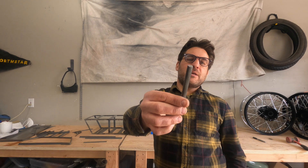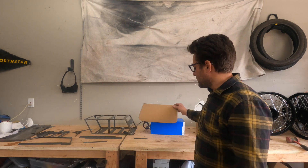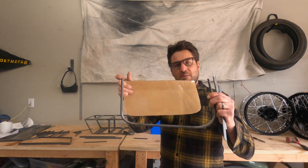As far as creating the battery box, there's no real magic to it. Basically, if you can measure and have a little bit of fabrication skills, you can absolutely do it. The basic design for the battery box I used on the C200 and the CT90 all started with this 3/8 inch round stock. I first create a template out of cardboard, making sure that my battery will fit within this template, then I bend this stock so it matches the template.